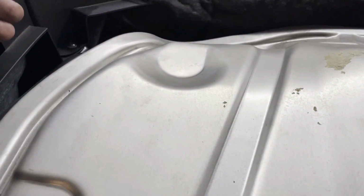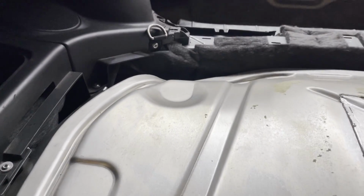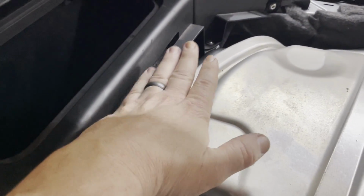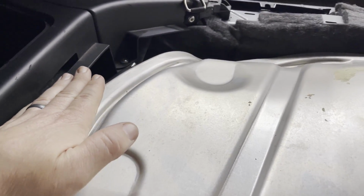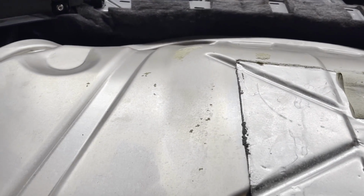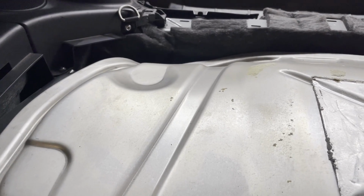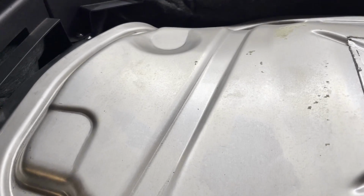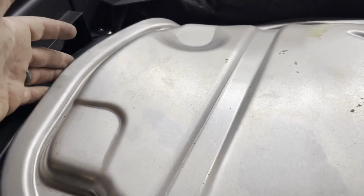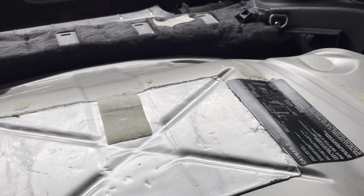But one interesting thing about Caymans is that I know there is a glass cover that goes in place of this engine cover, so you can actually see the engine bay. I've looked at those glass covers, and it basically sits in here, on top of this space. Technically, if you were to get one of those glass covers and have it sit on this ledge all the way around, that's how it fits, you wouldn't have any engine clearance issues. You'd be able to see the engine, and technically you could still run a stock Honda K-Series valve cover. You wouldn't have to go with a low profile one, but if you did run the low profile one, I believe that would give you enough clearance so you could just refit this OEM engine cover.